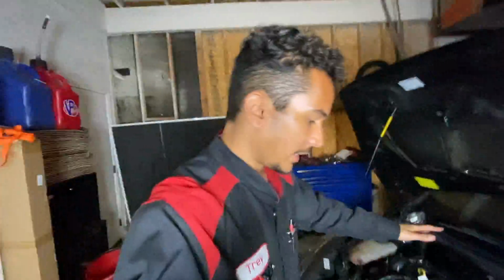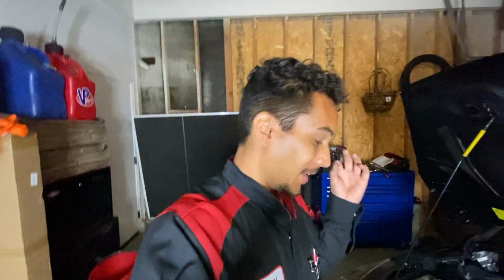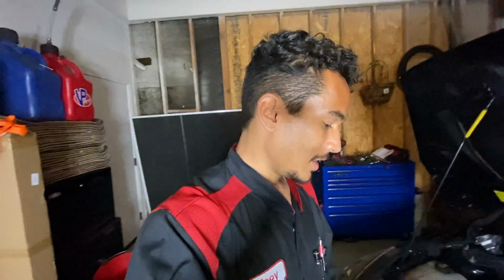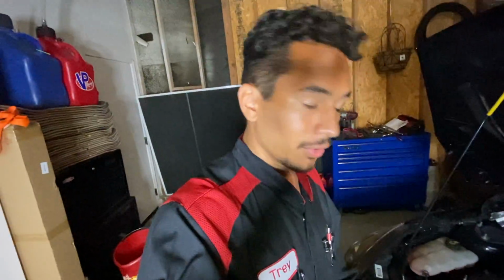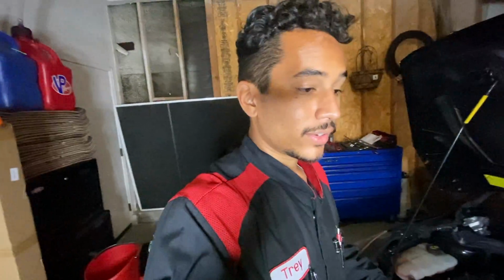But regardless of all that, our goal for tonight and tomorrow, hopefully, is to knock this out in a couple hours. I feel like at this point, this is my only option so that these bolts don't keep backing out. I figured I would use red Loctite. I mean, I could, but I don't really need to if we're going to be tacking it. But I'll think of what I have to do once I have the turbo out, and I'll figure it out. But as of right now, I'm going to get this thing out.